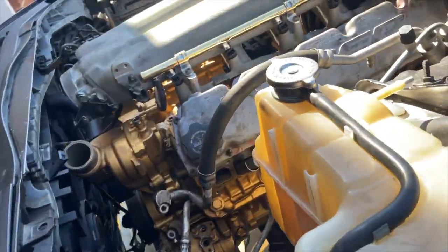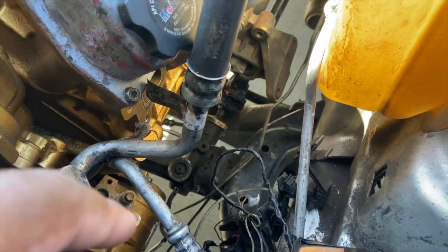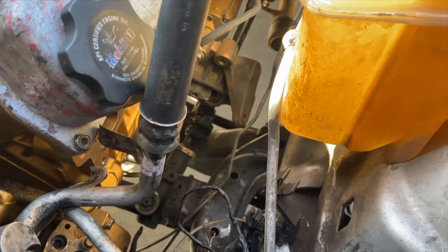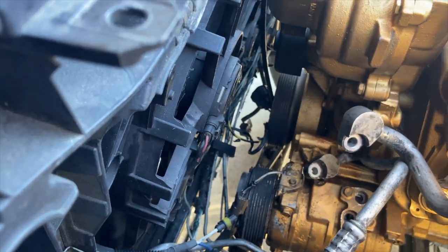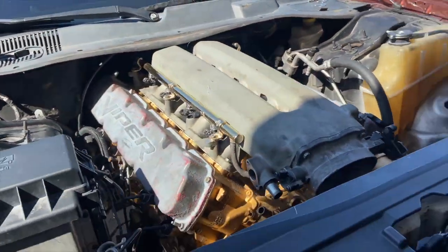That being said, we got a little bit to figure out. Like I said, a lot will drop once I put the motor mounts in and get them welded in — once I get it welded in, I drop it down. I should be good. The only thing I'm worrying about is the steering column, hopefully I don't hit that — cause I should be able to come up some. And then my fans and radiator will be custom made, and I'll probably move these old ones to give me room to come forward. My custom ones I'll probably put closer to the grill on this side.